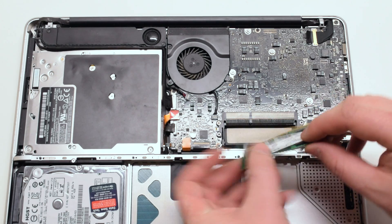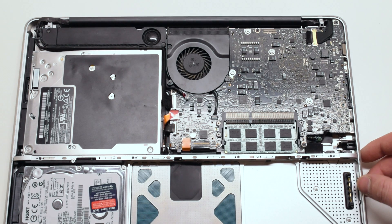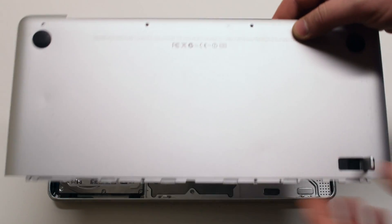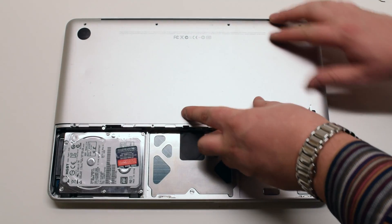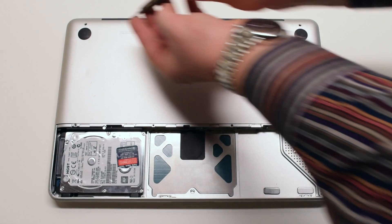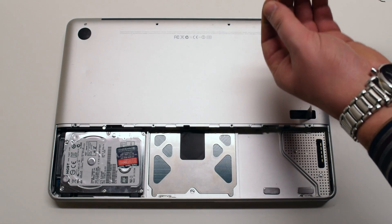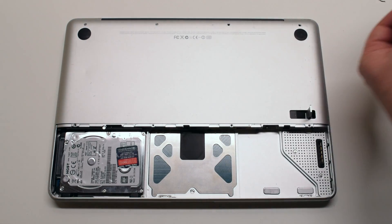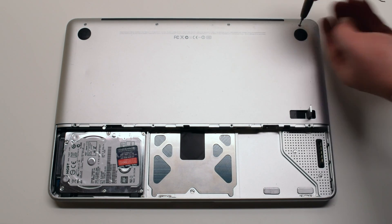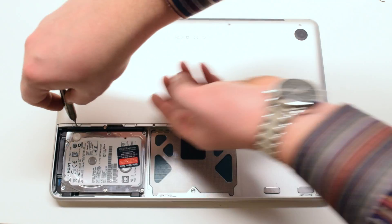Place the RAM module at a 45-degree angle, then gently press down on it until you hear it firmly click. Place the bottom case panel in the same manner that it was removed, gently pressing down making sure that no cable connections are being pinched off. Reinstall the top four screws starting with the shorter top left screw and then the three longer screws. Now reinstall the four smaller bottom screws for the panel to finish attaching it.